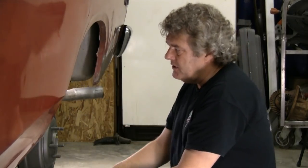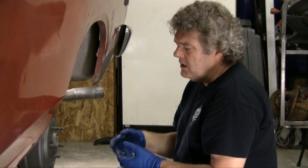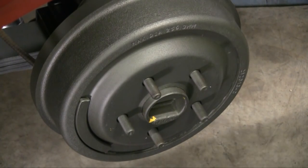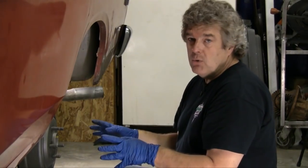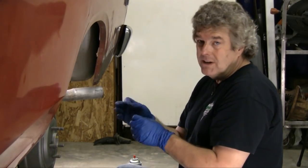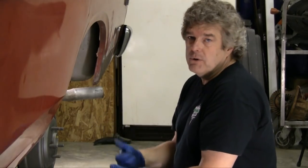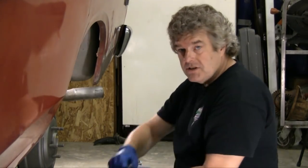We've got these in here and it's all ready to go on this side. I'll need to go and do the other side, but we're not going to show you that because it's the same thing just on the other side of the car. Adjusting them is fairly straightforward according to the Ford manual — you would take the car out, drive it onto a flat surface, go forward and then back up, forward, back up, applying about 50 pounds of pressure to the brakes. If your adjusters are properly greased, the brakes will work just fine. We've also got to put a brake line in here because the originals have a lot of rust inside of them, so we're going to replace those with some classic tube lines. Next we're going to show you that, then how to bleed down a classic car braking system, and maybe how to adjust the rear brakes. Come back and watch this next time on Auto Resto Mod. Have a great week, folks.